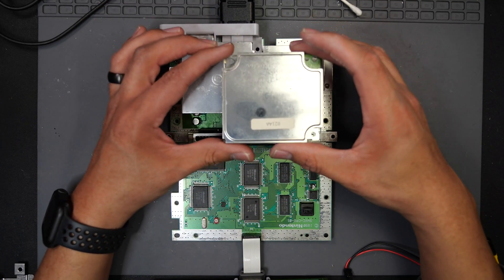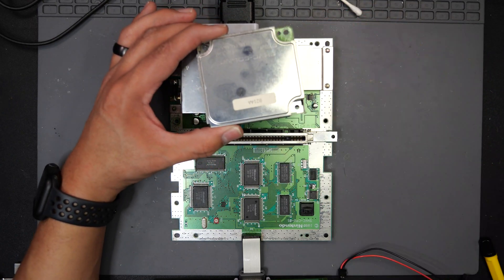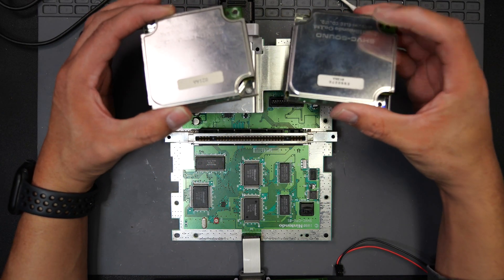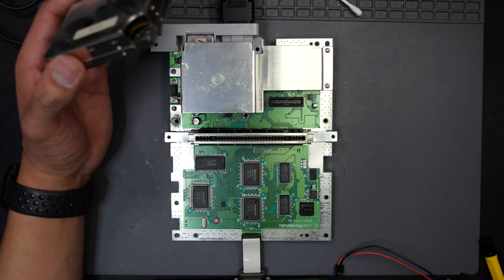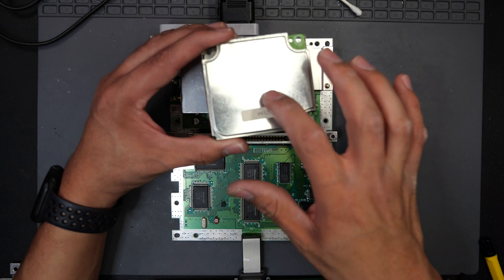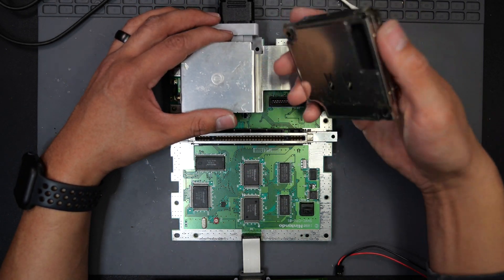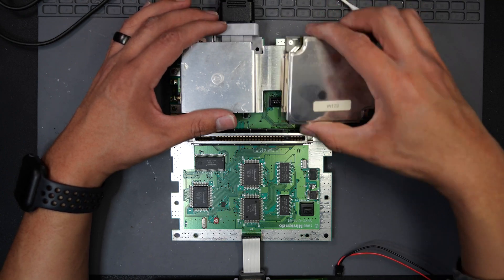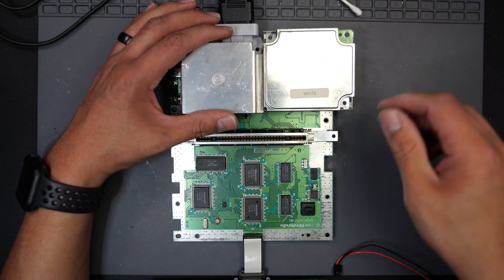All right, I'm going to throw in his soundboard. I believe it's fine — the only reason I say that is because I know this one works, but it has a weird sound issue. It wasn't working completely in this one either, so I'm guessing I'm going to try to rule this piece out as well. If you are getting weird sounds it's worth trying just swapping this piece. This is actually the soundboard itself — I just don't think the audio was getting to the soundboard.